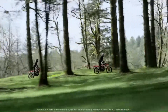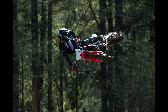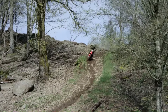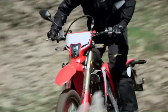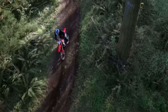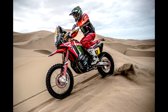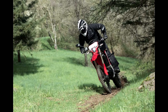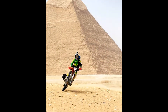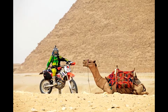Unfortunately, you're still going to have the relatively short service intervals, because the 450L is just a detuned CRF450R motor — a highly strung race engine with a pretty small oil capacity. Yes, there are some changes; it's got about 10 horsepower less and a different piston, but it's extremely similar. Look, 1,000km service intervals are pretty good for a dedicated dirt bike — that's a lot of single track and weekends of riding, and not even bad for some light adventure work. But what we really need is something between the road-based 250L intervals and the 450L intervals. Look at Adam Rehman on his KTM EXC 500s — he rode from Austria to Egypt stretching out intervals with no problems, but he was supplied those bikes by KTM. If it was my own bike and my own money, I'd be pretty reluctant to do that.